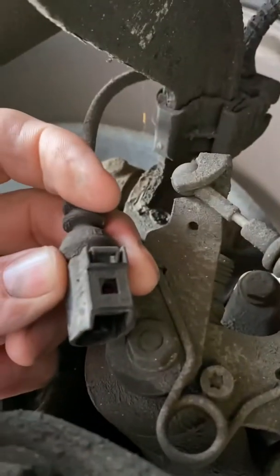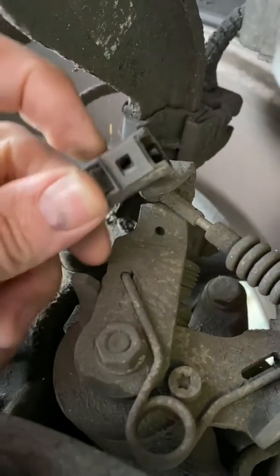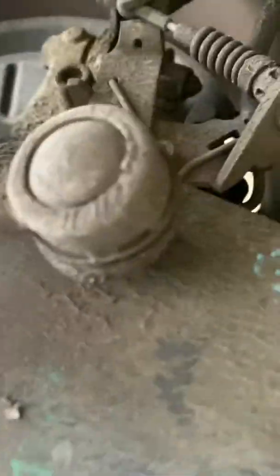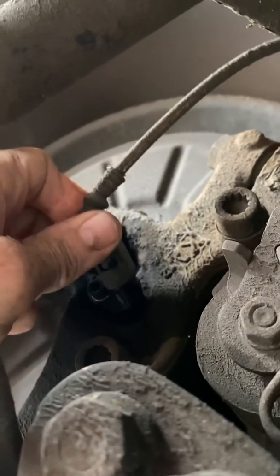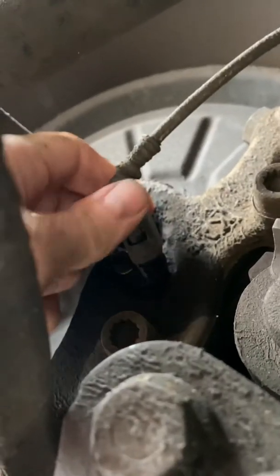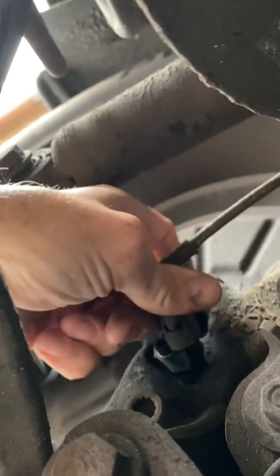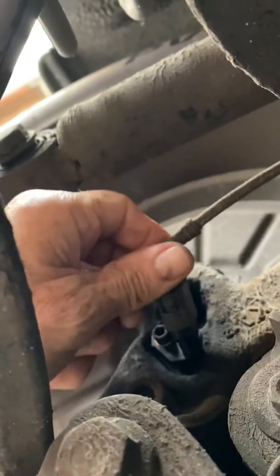A little word of warning with these clips — you have to pull that little edge here back, which will then raise that little tongue up, which engages on a little clip at the back of the sensor. When I put it back on, you will hear the clip engage, like that. The seal puts a bit of weight on it, so to get the things off, you need to push them in a bit first before you pull that little tab back and pull them off. Push in, pull back — if you just try to pull it straight back, you'll end up breaking the tab off and then you'll be into a whole world of pain. So be patient, learn the knack for it — they do come off quite easily.